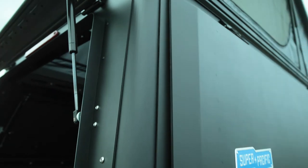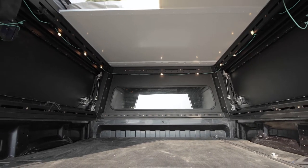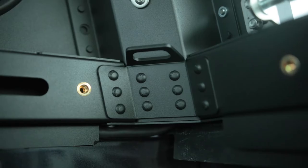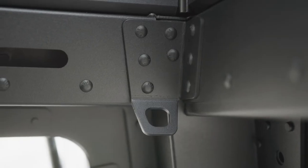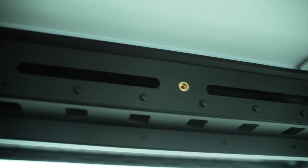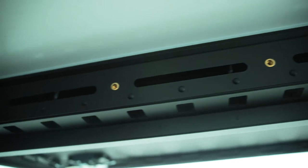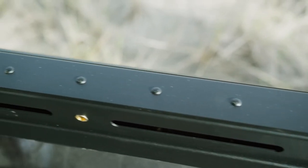The canopy of the Switchback X1 is designed like an airplane. It's made out of formed and riveted aluminum. It's super lightweight, super strong. Airplanes have been built like this for almost a hundred years and it's a tried and true method of fabrication. The framework of the fuselage is all basically box beam construction. Box beams are used on most of your pickup truck frames and it allows for a very strong and very stiff structural element.